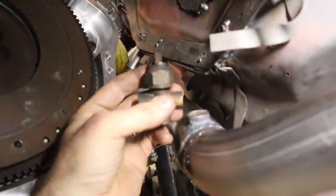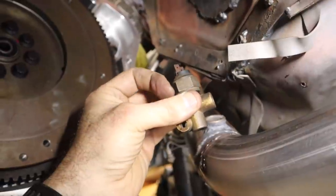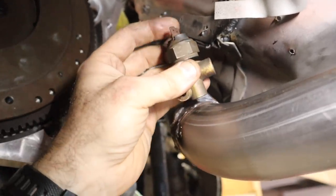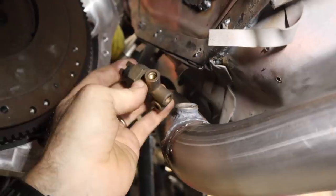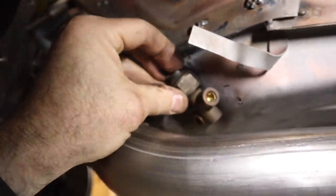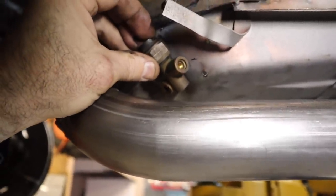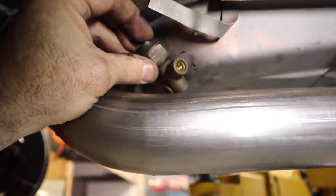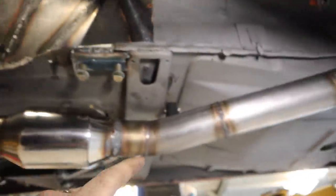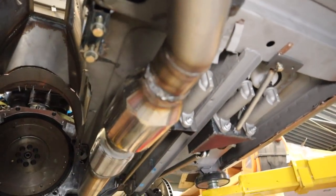I have been sitting here for the last half an hour trying to work out where I'm going to put my two-way brake pressure switch splitter. Basically this is going to be on the front brake circuit - it's a pressure switch that when you put your foot on the brakes, the pressure going through here switches this and switches your brake lights on. I've been trying to fit it all over the place where it's not going to get in the way of putting the engine in and out, or the gearbox, or the exhaust. The only place I can really put it is tucked up here, yes again close to the exhaust which will be heat wrapped - but it's the only place I can put this valve. So now I need to mount the valve, then run my lines back to my master cylinders.